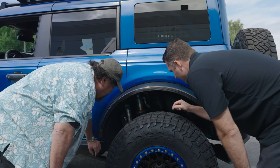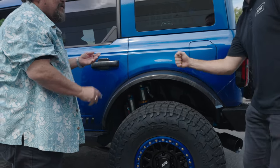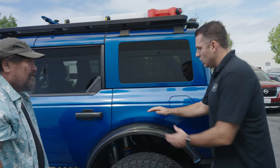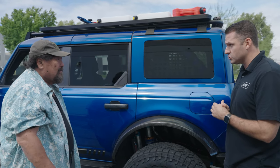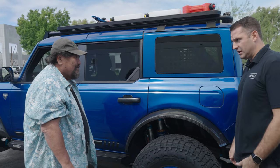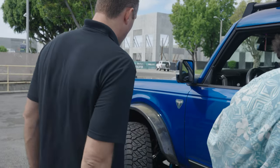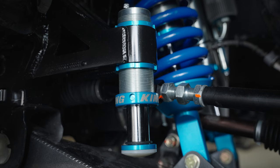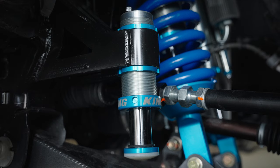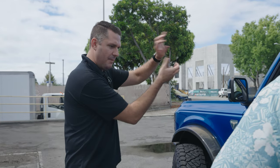Last thing is bump stops. You'll notice the bump stops are threaded mostly down, which is going to restrict that up travel. With this body system and our travel, we had to prevent tire impact with these factory body panels. We're on a pro runner body that's enlarged, opened up, and wider to allow that travel to cycle up higher. You're still getting about 14 and a half to 15 inches of usable wheel travel front and rear — more than any of the Ford products from the production run, including the Raptor models. If you switch to a larger tire or a different body system, the suspension is all modular. All you have to do to change the entire suspension setup is take those bump stops, loosen the jams, and thread them up. That will no longer restrict the up travel. You're not revalving, not replacing parts, not rewelding — you're just twisting, moving something up, and tightening it. And you're done.